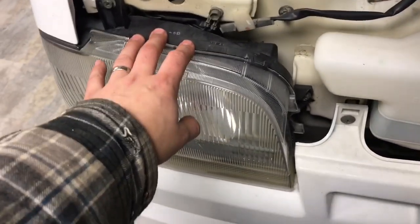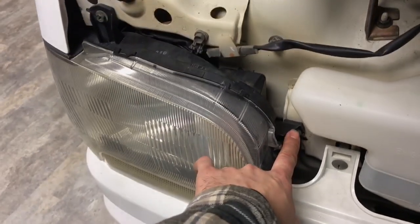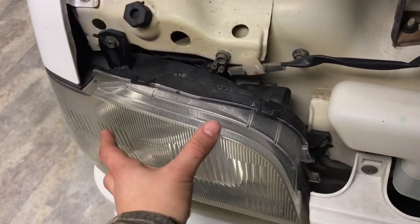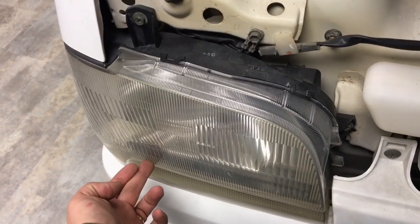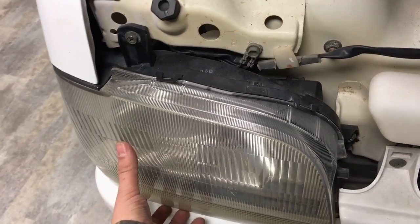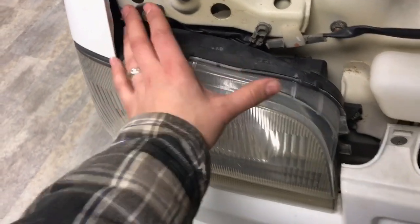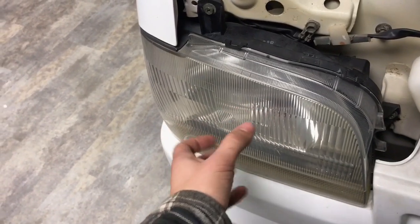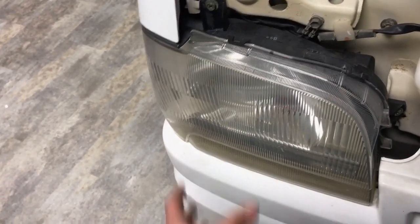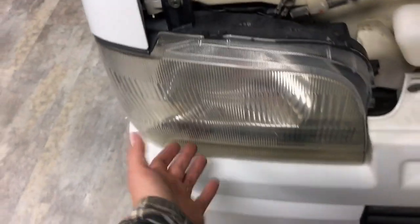One little hint with the headlights — they use a standard H4 bulb on this style of truck. There's basically one bolt here, one bolt there, and then one last thing holding the headlight on is a steel pin at the very back that goes into a plastic sleeve to keep the bottom from being wobbly. Those tend to get stuck after a while, so if you take off those two bolts and find your headlight is loose but won't come out, you just have to work it slowly and hopefully pop it out without breaking that little stud off.